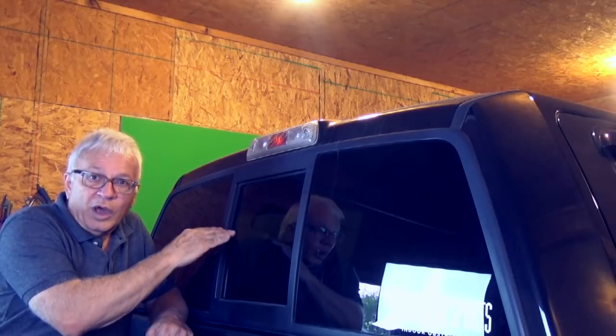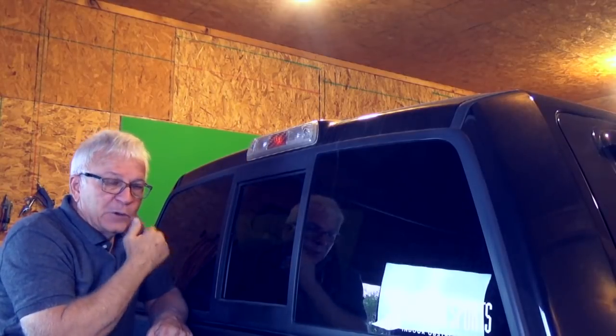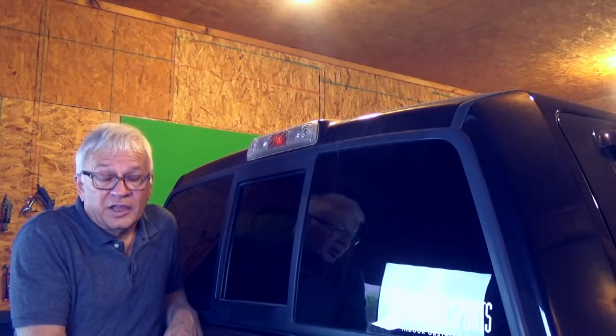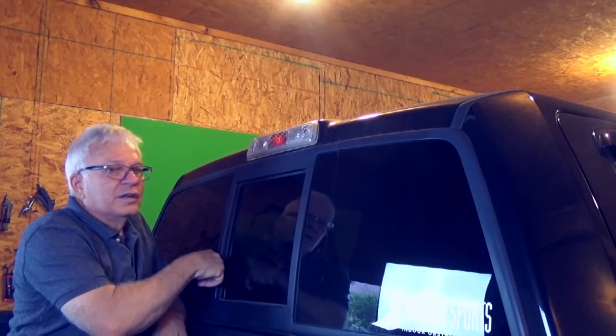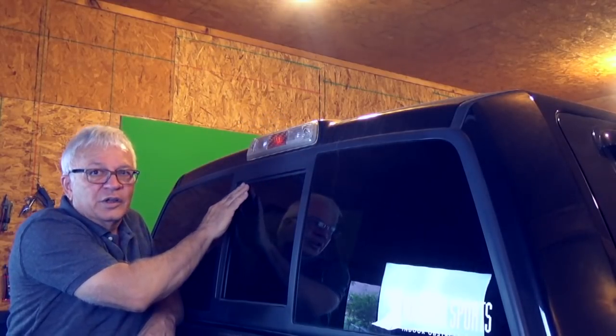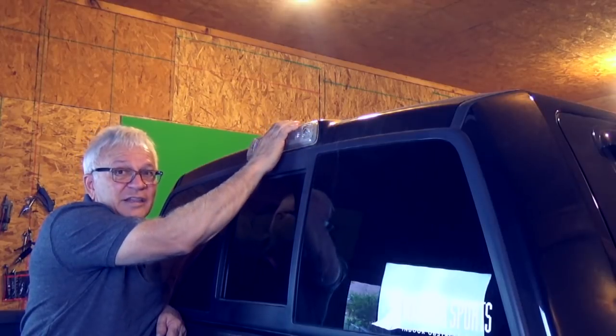Let's think about this for a minute. On the inside of the cab, the water marks on the headliner were up here on the very top. Now could the water be leaking through this window? It has a seal here because this is a window that will open and close, so yeah, it's possible. Let's use the smoke to see if we get smoke inside the cab. The roof is solid metal and there's no holes through it. We do have some seals around here and some seals around this light. Now if the water was leaking here, gravity would push it in and down, but I can't see it making the headliner up there get wet.